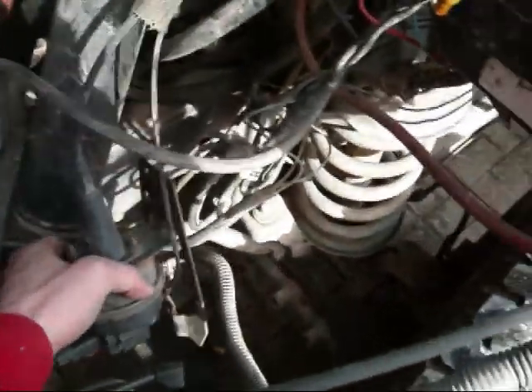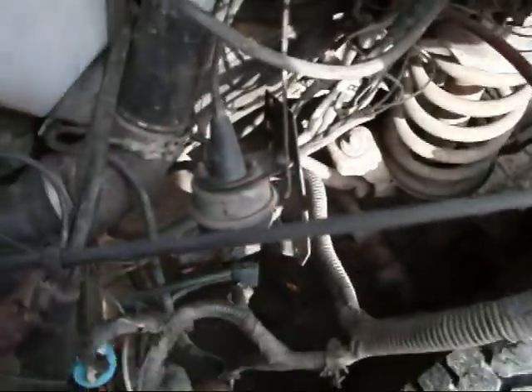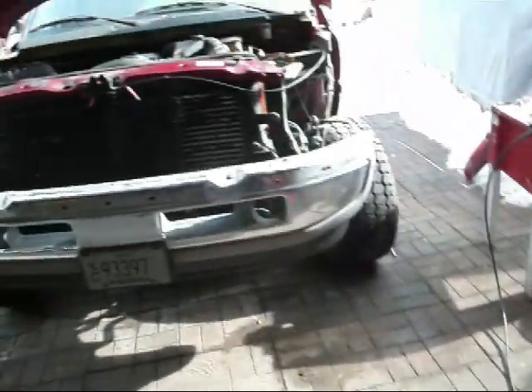I got the left fender off. This one's even more fun because you've got to unhook the cruise control, which bolts onto the bottom of the battery tray, and unbolt that. There's a plastic rivet in the back of the fuse box you've got to take off, plus unhook a whole bunch of wiring clips. The relays for the heat grids are bolted in — you've got to unbolt them, along with all kinds of wiring. Now you've got just about nothing left holding the radiator in the front. I'm going to do the same thing I did with the first fender — drill out all the spot welds, save this inner piece, and screw it into the new fender.